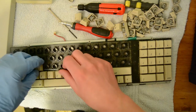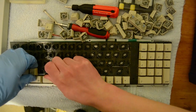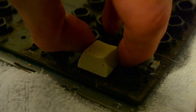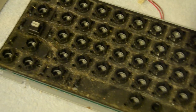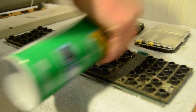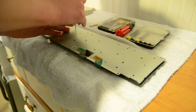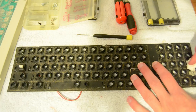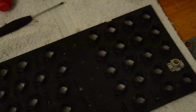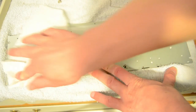Next came removing the keys from the keyboard. It's pretty important to lift straight up when removing these keys because there's some plastic at the bottom that you can break off if you lift at an angle. I don't have any fancy key remover, so I just used a small screwdriver — the best way is to slide it underneath the bottom of the key while at the same time pulling from underneath the top. Once the keys were removed, it was pretty apparent that this keyboard had seen a lot of use. There was about a decade's worth of gunk and dirt built up underneath. I took some compressed air to blow away loose dirt, then used a vacuum cleaner, and still had to wash away remaining dirt with a wet paper towel. I also hand-cleaned some gunk off the metal plate on the back of the keyboard.